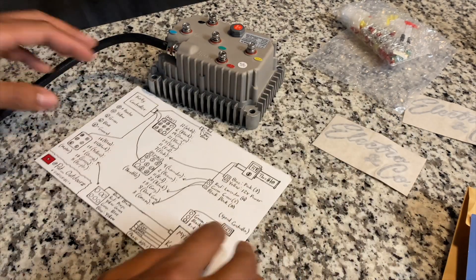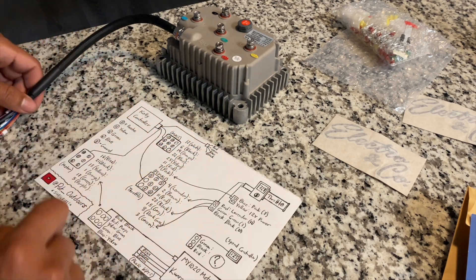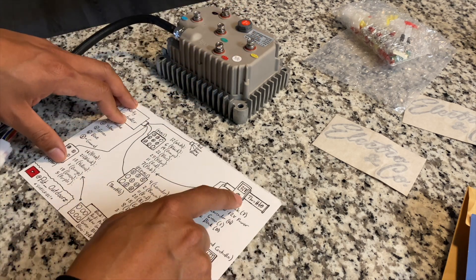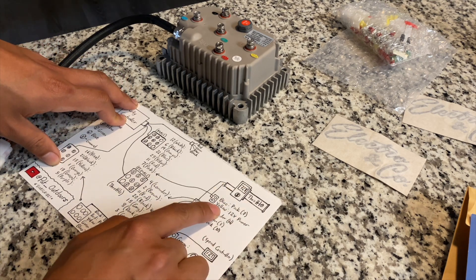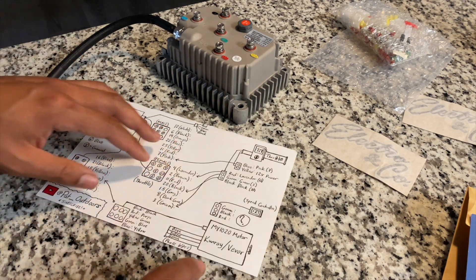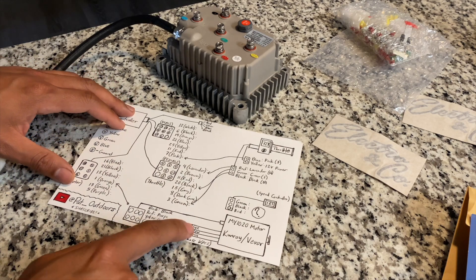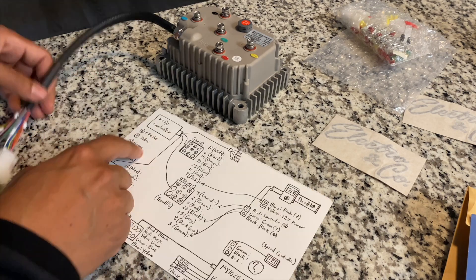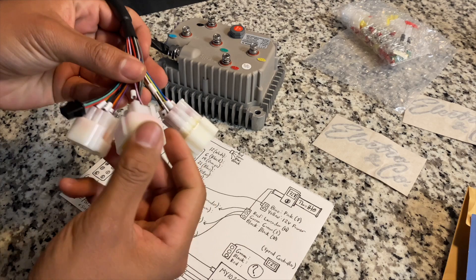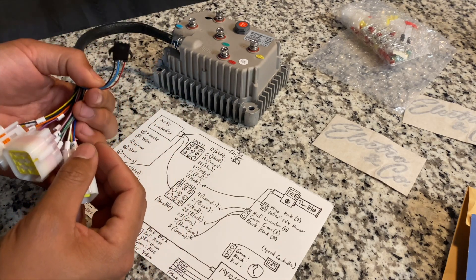Here's a rough wiring diagram I drew up as a guide to navigate all the wire connectors on the bike. This represents the Kelly controller with the four plugs coming out of the harness and the five posts on top of the controller. Here's the universal keyed throttle with a built-in voltmeter I got from Amazon for less than 20 bucks — I've used those three times already. There's also a universal speed controller and a MY1020 motor — doesn't matter if it's a Kunray or whatever, they're all designed the same. It has three phase wires and a six-pin plug coming out of it. All the connectors and wires on the Kelly controller are color-coded and numbered, so you can't get them mixed up. One thing I don't know the purpose of is the four-pin plug — if you happen to know, please comment below.